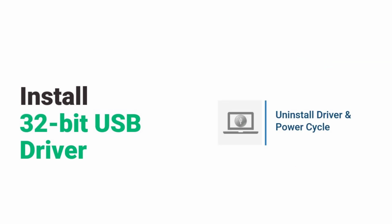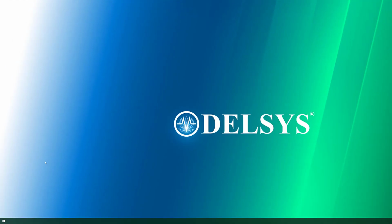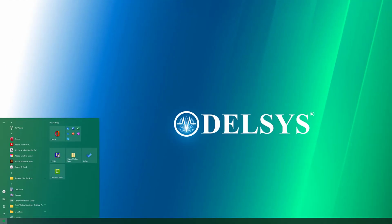If you currently have the 64-bit USB driver installed and need to operate a 32-bit software program, then please follow the uninstall and power cycle process. You'll first need to remove the 64-bit USB driver from the computer.